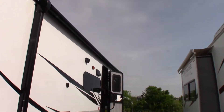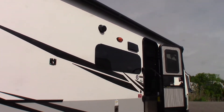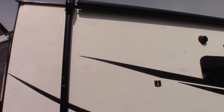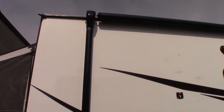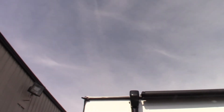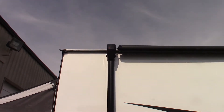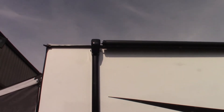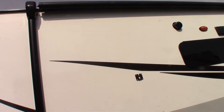You need to go up on the roof or have somebody go up there every 90 days or so and inspect the seals on the roof. You're looking for cracking or separation in any of the sealant — someday you're going to see that happening. Like all trailers, you have to inspect them and caulk them when needed. When you do see that, take care of it immediately. This uses a lap sealant called Dicor — always use the right stuff on the trailer, don't just go to the hardware store. When you inspect the roof, look at the roofing material for damage from low branches and make sure none of the vent covers are damaged. Just give it a good once-over.